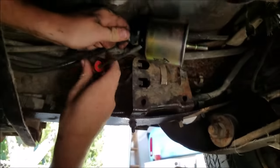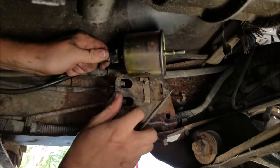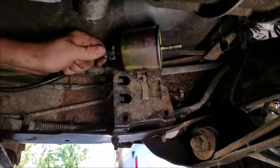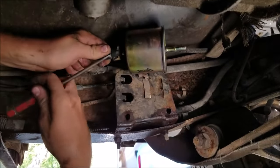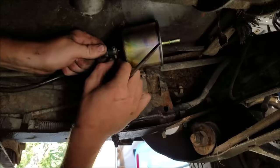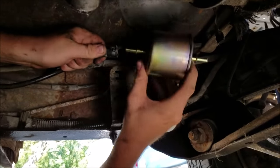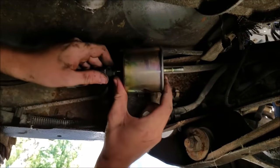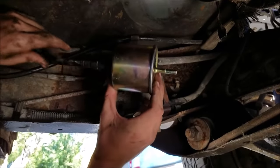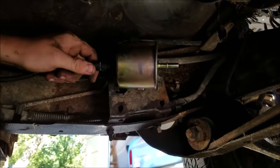Down here under the truck - Ford's fuel filters only have two designs. One uses a slip-in retainer that pushes pins back or pushes a collar back; those are junk. Or this one, which is really simple: you slip under here, pop this plastic deal off entirely, and then simply remove the filter. To install the new filter, simply plug it in, make sure you've got a good seat with no bends or cracks in your line, slip your new retainer in, put it back in place, and you're done.